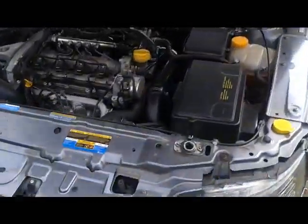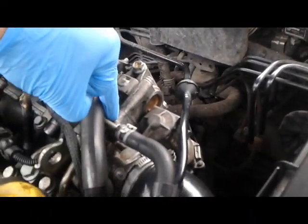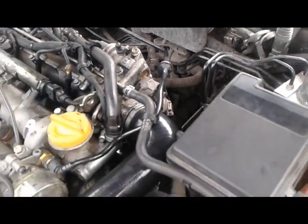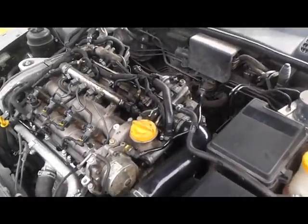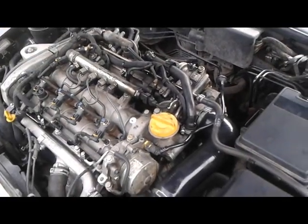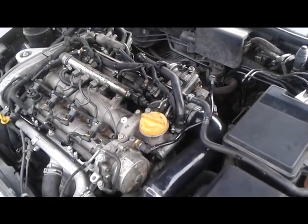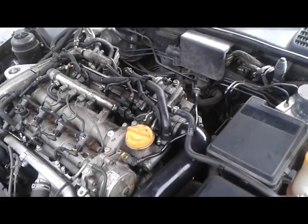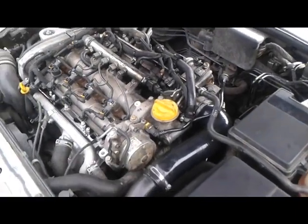One thing I didn't say in the video: when you're flushing out all the internals of the manifold in here with the parts cleaner, you have to wait several hours before you can start the engine to make sure that all that cleaner isn't going to damage the engine when you start it. I waited 2.5 hours and she started up fine — just been for a drive and everything seems fine, no more codes.